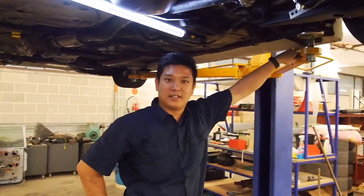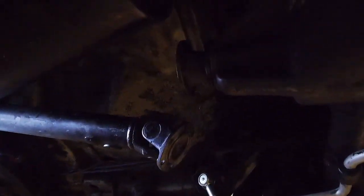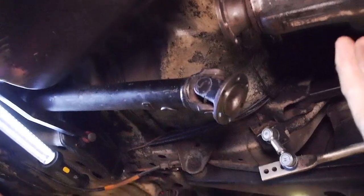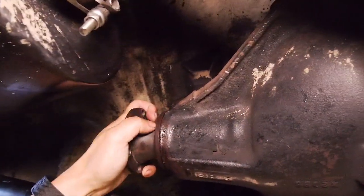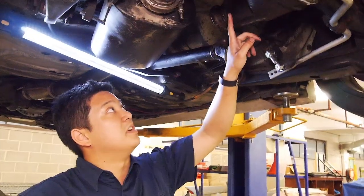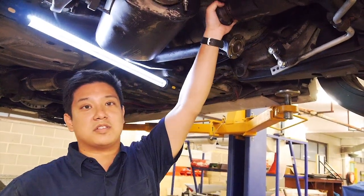So as you probably saw on the video it was kind of cut short. It feels like something has given us a false positive when we were getting the lash on this. It looks like one of the bearing races - look at this, that's fucking loose now, and that was beautiful before. This rear one most likely wasn't pressed in all the way when the preload was being set, so under load it's moved.